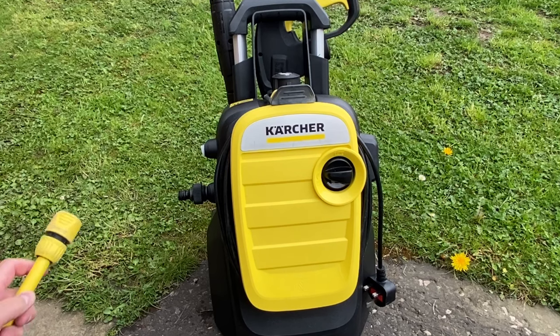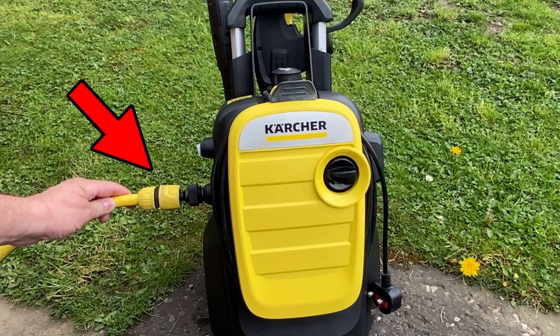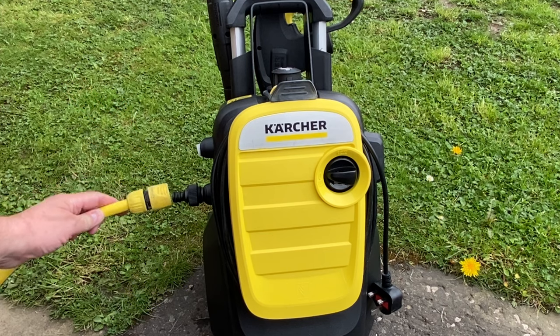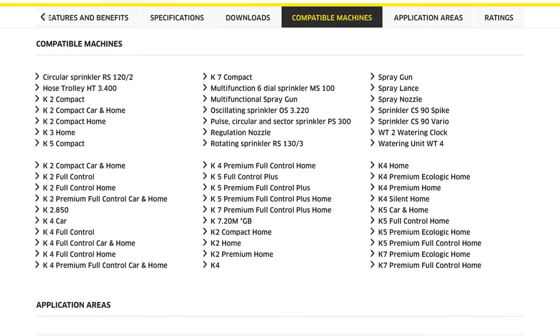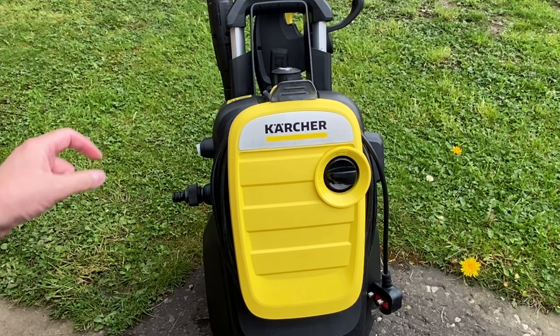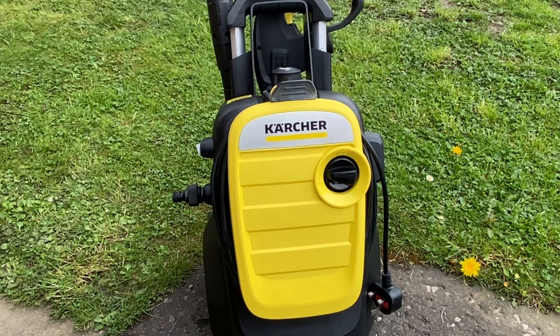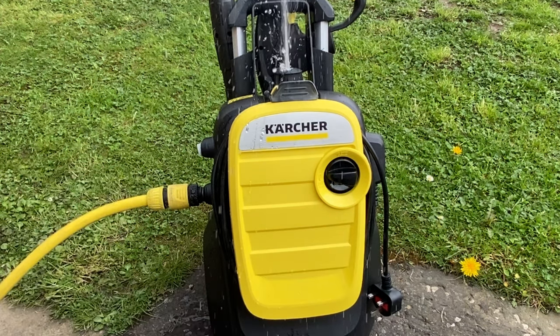Let's get it connected to the water supply. I'm using a Karcher branded hose attachment with AquaStop. Personally I've never had a problem using one, but some pressure washer manufacturers don't recommend them due to the back pressure. The Karcher one is actually recommended for use with the K5 Compact on the Karcher website. It is important with any of the compact machines that you connect the hose and the gun attachment before you connect up the water supply, or you'll get a face full of water as I've done on quite a few occasions.